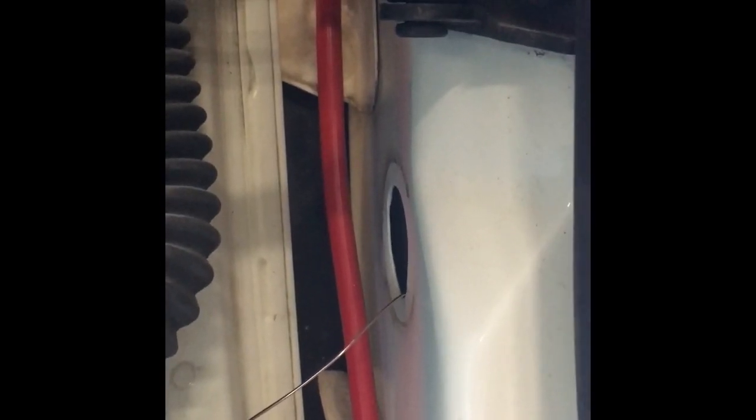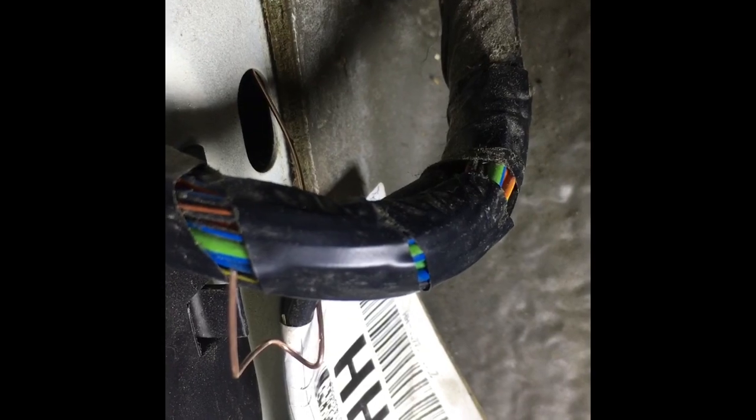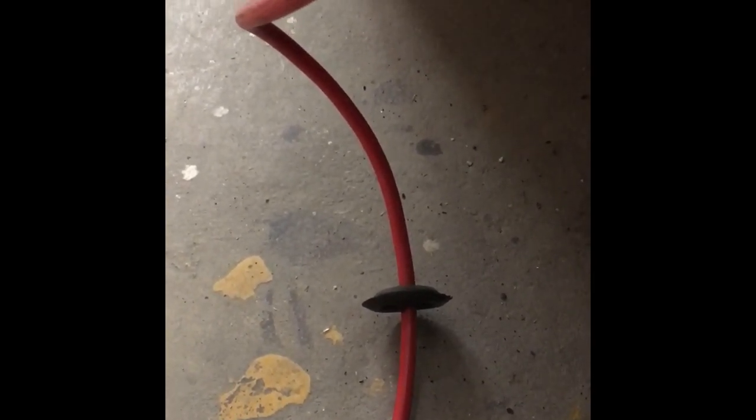Just below that bracket there's the opening where I've taken a grommet out and threaded the MIG wire through, and it comes out just inside there, as you can see. Don't forget to put the grommet through the cable first, obviously — otherwise you can't do it after. I've just drilled a small pilot hole; you don't need a very big hole through the grommet because it will stretch, and it'll also stop water getting in. You can always put a bit of silicone seal around there after as well.